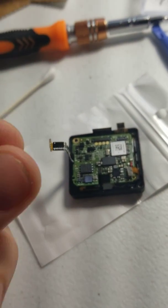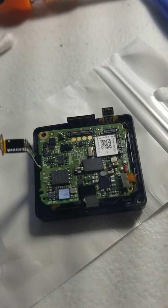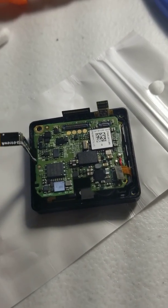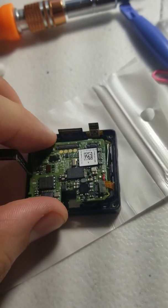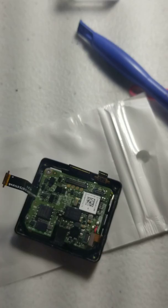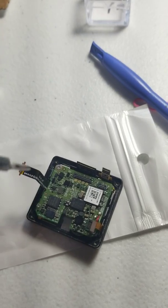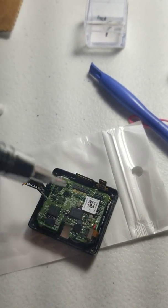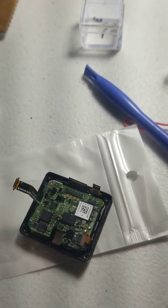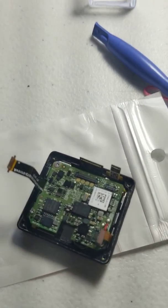At this point, you really want to make sure your hands are clean and dry — hit it with some rubbing alcohol or Goo Gone to get that adhesive off so when you're working with the motherboard and these connectors you don't get any residue on the actual motherboard or the connectors. So once you have your battery and the vibration module back in place and everything aligned, you can put the motherboard back where it goes and get your three screws back in. Go around in a circular pattern — they just need to be finger tight, don't crank them down and you don't want to strip them. Go around until they're all finger tight and a little bit snug so it's not going to loosen up.